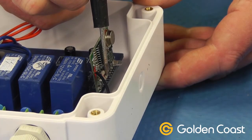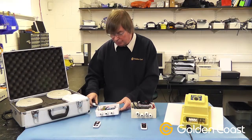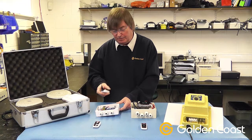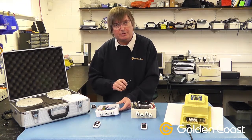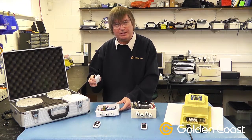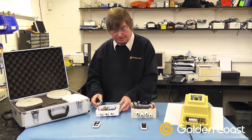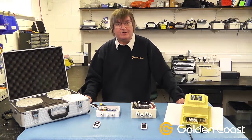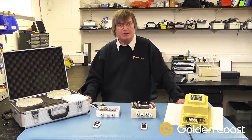While you've got the white button held down with the screwdriver, on the remote control press color and then on/off. Once you've done that, release the white button and the remote controls are then resynchronized with the box. This applies to both units, whichever one it is.